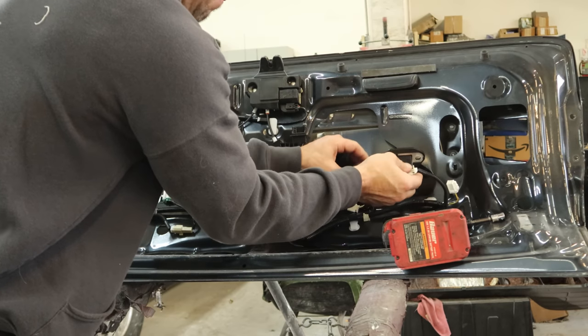We'll take this Christmas tree out to take this cover off so we can get to everything else. Pop all the cables off for our lock assembly, unbolt our camera, and we'll start popping off the wiring harness — it's only part of a wiring harness since it was cut when we took the deck lid off, so we don't have to worry about saving it. Now I can pop our finish panel off the back of our deck lid — fun fact, this is about $700 from Lexus. Take our little paper covers off there, fish our camera out, pop our license plate lights out. And there's our broken license plate bolts that are available on any Toyota model that's had its license plates on for more than a year in the Rust Belt. We'll have to get those out later.